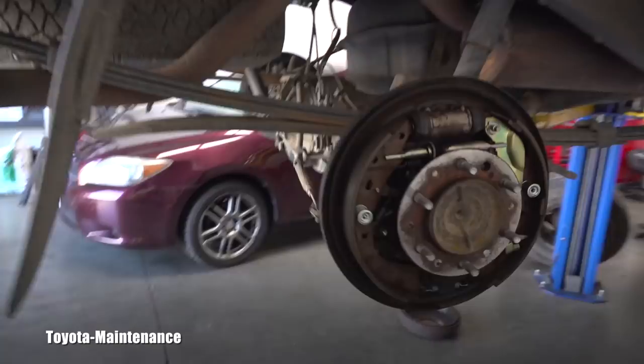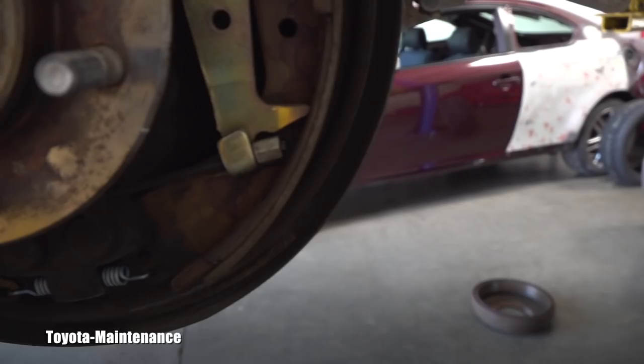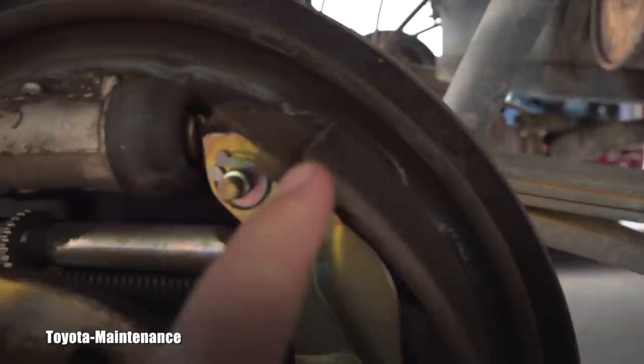Let me confirm it on the other side. If you see this, don't panic — it's not something wrong, this is pretty common. Almost every single time I do this inspection I see that the front lower part could start at four millimeters but on the bottom in this area will be approximately two millimeters.